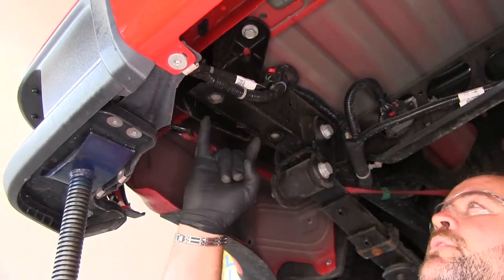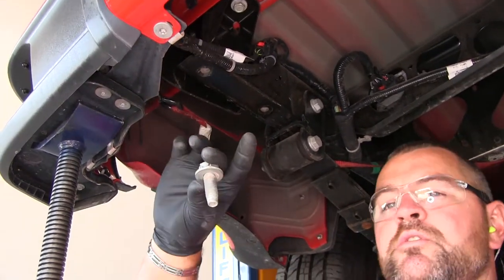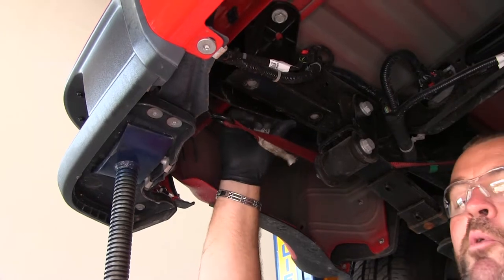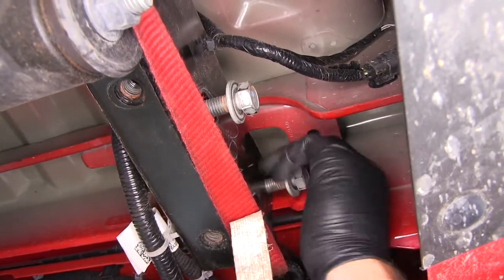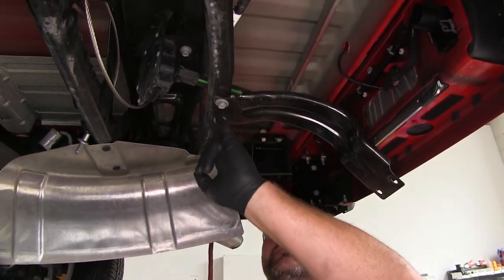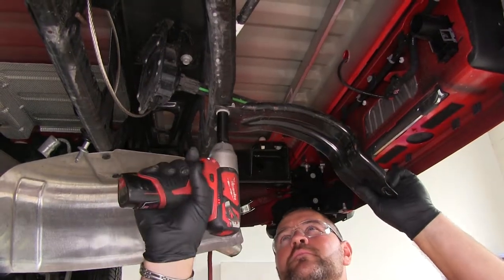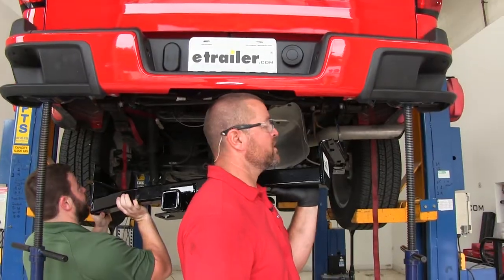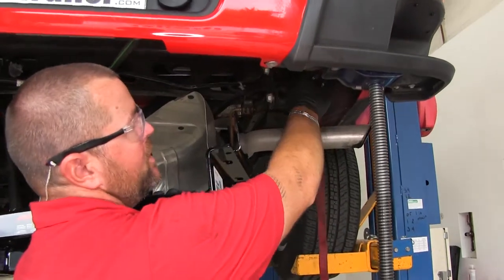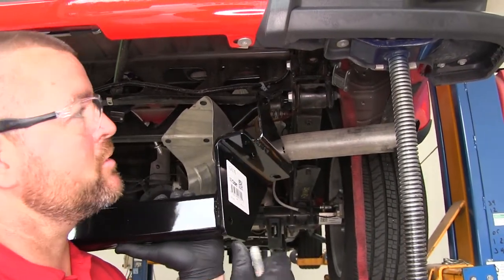The hitch is only going to be utilizing the two holes on the bottom of the frame rail and the two in the center for the spare tire holder. We're going to take the existing hardware we removed and put it on the outside of the frame rail to help hold the bumper in place. Once all hardware is removed from both frame rails, go ahead and remove the two bolts holding up the spare tire bracket — we will not be reinstalling that. With an extra set of hands, the side plate goes up on the outside of the bumper plate on the outside of the frame rail. Put one bolt on each side to hold the hitch into place so you can get the rest of the hardware in.